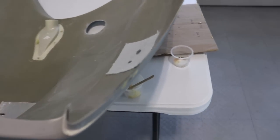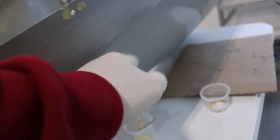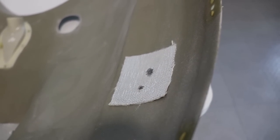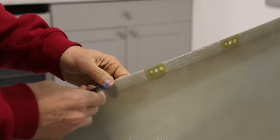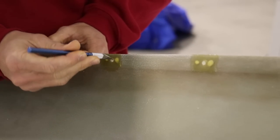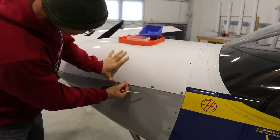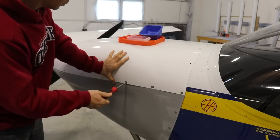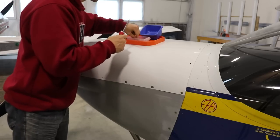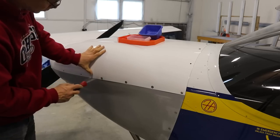Once that's done I'll probably cut this out of the cowling and from the outside putty and fiberglass on a little blister to give that cowling some room. Now that the resin is dry, I'm just using an exacto blade to go around the big hole and cut out that little bit of fiberglass cloth covering the center hole — quick and easy. All that peanut butter and resin has dried, I've sanded it smooth, installed all the new nut plates, and now I need to put the cowling back on because on the top cowl I need to paint the yellow and blue, and I need to see exactly where to mask off those tape lines.